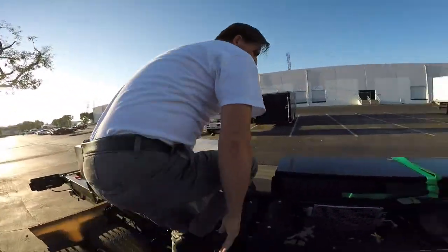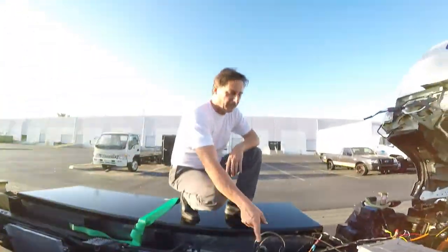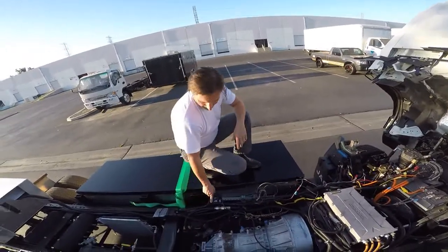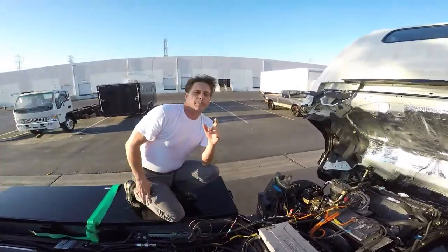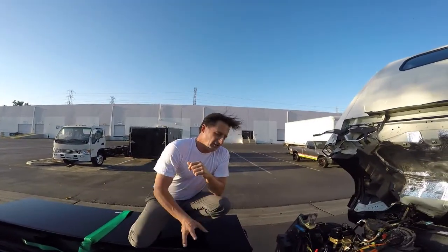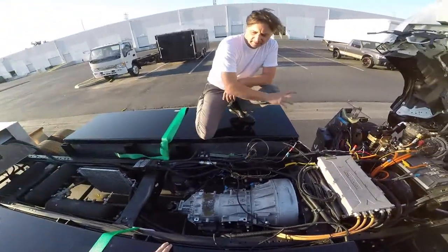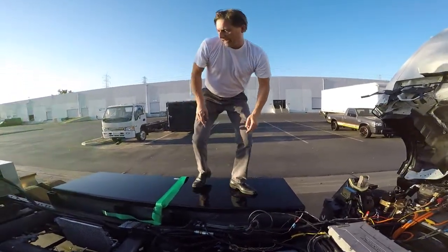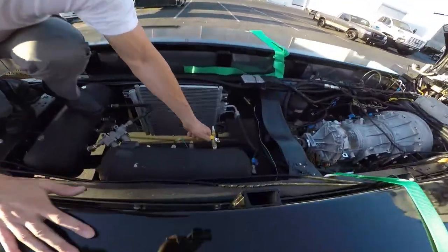If you look down in here you can see the electric motor — that's a 200 kilowatt motor. Here's one of the best things, here's what no one has done yet: I have used the OEM Allison transmission, hooked it up to the electric motor, and I've also used the OEM Allison TCM with all the same plugs and all the same wiring. All this wiring you see is going to be cleaned up — this is a prototype stage. We're going to go into production stage — the inverter is going to be in a waterproof box, all these wires are going to be gone, replaced with some of the OEM wires. These are the battery packs I'm standing on right now, and right here you've got the OEM Allison transmission cooler and the air tanks for the brakes.